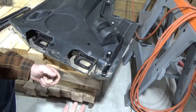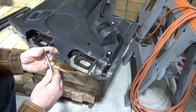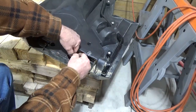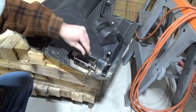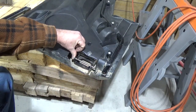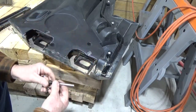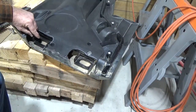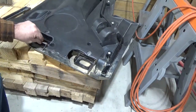I'm a fan of not altering your machine, but these are such a pain in the butt to take apart — you've got those little C-clips. This is a hair pin — real quick, easy, and fast. This is a patent-pending fix for all of this. Once you stick this in and set your door on, I recommend using needle-nose pliers to hang on to the end of it to get it started. Then you put it in there and you can see how that goes — you cannot turn that pin, so you're not going to have any wear on the hinge. Put your cotter pin or hair pin in there and you're good to go. Do the top the same way — easy peasy — and eliminate the wear. You can take these off in seconds: just pull the pins, lift up on the door, and your door is off without having to take all those panels apart. They just slide right in there and they do not move — they lock on the back side.